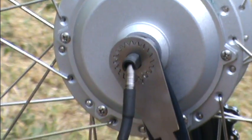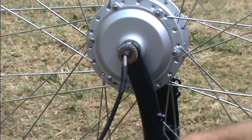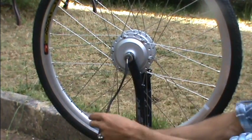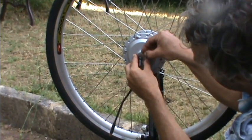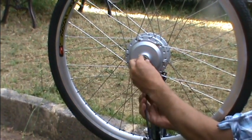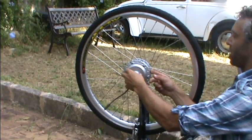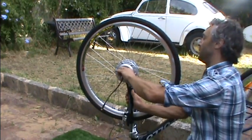Line it up as well as you can with the fork. Sometimes there's a recess here in the fork, in which case what you have to do is put this in a vise, bang it with a hammer and put a nice bend in it, then put it on, tighten the nuts, bang it back against the fork and then clamp it. This is the most important and slightly tricky bit — it's really just an extra safety feature. If you have a good set of chromoly steel forks then it's probably not necessary, but I recommend putting it on all the time as a safety feature. You cannot put these kits on carbon fibre forks — you run a very serious risk of snapping the forks. Steel is the best. These ones are alloy but they work okay with these mini motors. Typically if it's not steel you don't want to do anything over 200 or 300 watts.